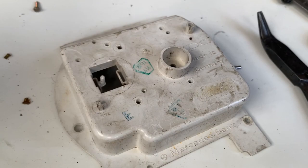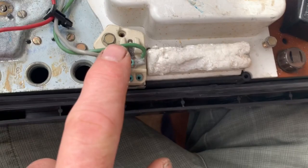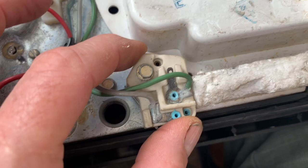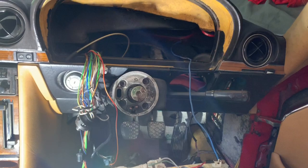We're going to use a soft brass brush to clean the rusted area — you can get a set of three brushes for about a pound. We won't be needing the steel one but we might just use the nylon one to take away any dust. Those two screws out, that metal plate around the magnet comes off and we can give that a good clean. Putting this bit back together is simply the opposite of taking it apart. Just bear in mind that the plastic cover is not symmetrical — it has a cutout which goes on the copper wire side, and the top of it needs to slip underneath that green component to get it back in. We just need the white casing on — those four rubber grommets are where the screws go. Tighten those screws carefully as you're screwing into plastic and you don't want to crack that.